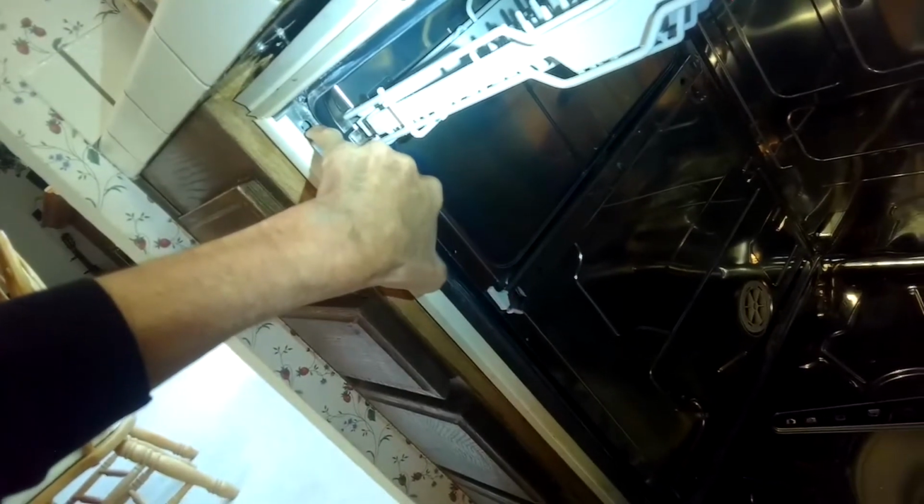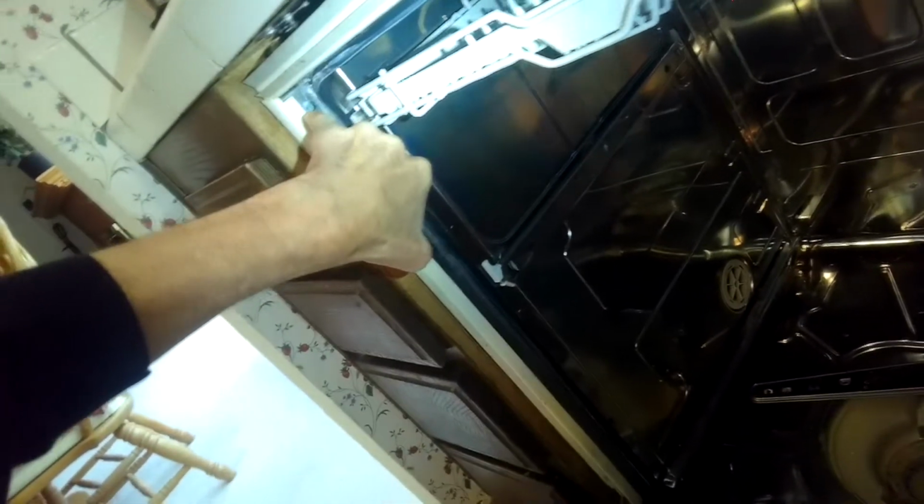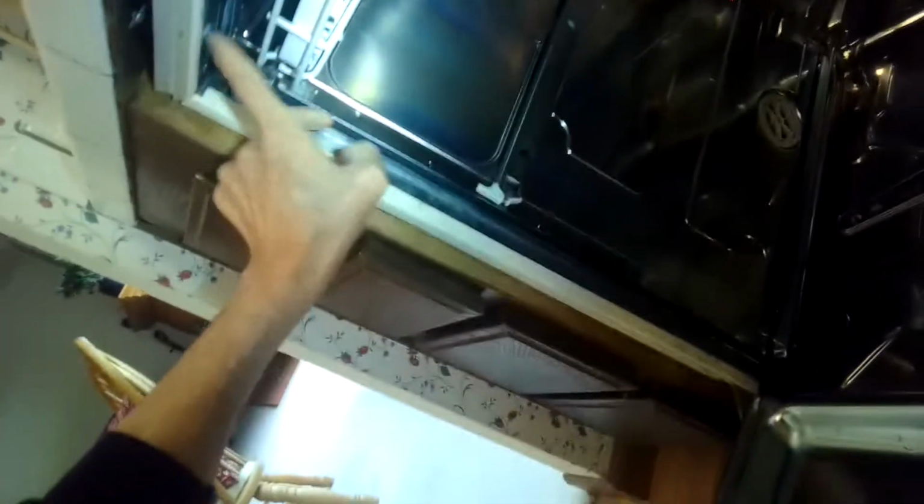Okay. Get the machine out of the cabinet. You need to remove a couple of Phillips head screws, or there might be Torx 20 screws, one there is possible, or one up. This one has them in the up position, so we're going to zip those out, and then we're going to also remove the kick plate from underneath. So we got one of the screws. Here's another one right here. These are just Phillips heads. Sometimes these will be Torx 15, I think.